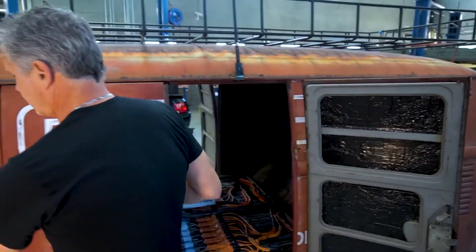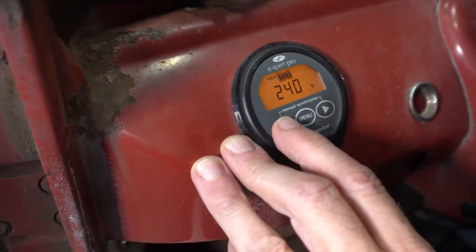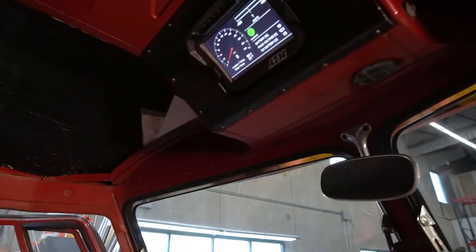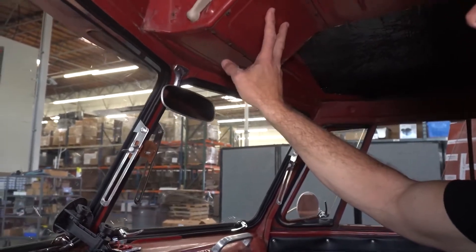This actually could be one of my favorite areas. The display before was this 52mm piece — it gave you battery voltage, current push and pull based on regen or amperage consumption under acceleration, percentage of the battery, and total pack voltage. It did work, but the details weren't there. Now one of my favorite features is the use of our CD5 here. It's mounted up in the center, and we have a lot more information — really easy to see. You can see what gear you're in, what mode you're in, the push/pull of current consumption, and the actual calculated range left in the battery — just like you have on a regular ICE car with mileage, instant fuel economy, and range till empty.